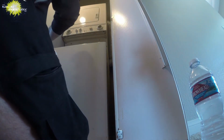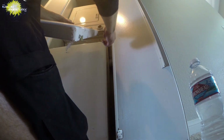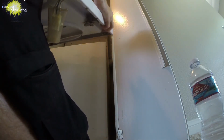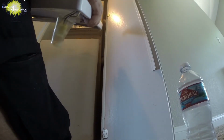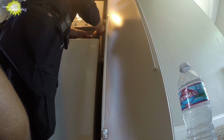Got our lid switch, or our lid, and our disconnect. These have the two flat deals here. These right here. You want to make sure you don't lose those. Some people will tape them on to make it a little easier. I just hold it the right way so that they don't drop and go through. If they go through, you just have to reorient them through the hole. A little bit tricky, but possible. And don't forget to plug in your disconnect switch.